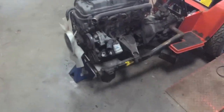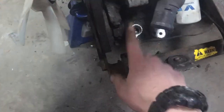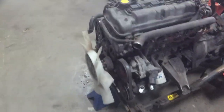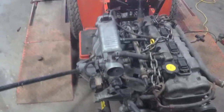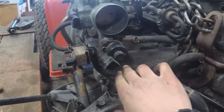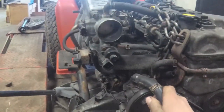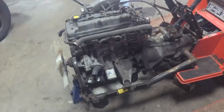We're going to use the AC condenser fan off the Tracker — we don't need the clutch and all that. This is for packaging purposes. We have to get the shorter belt for the Tracker without AC, get rid of the compressor, put an idler pulley on it, delete the power steering pump, and put a pulley there. Then make a new intake — but that new intake will only be once I get it wired up and running. Then I know it all works, and then I'm gonna make a new intake kind of like the Skunk 2 ones for the Hondas, where the runners come straight out. The long runners give you more low-end power, but it's not gonna matter on something that's gonna weigh in at like 600 pounds total with 130 horsepower. We don't need to worry about that.